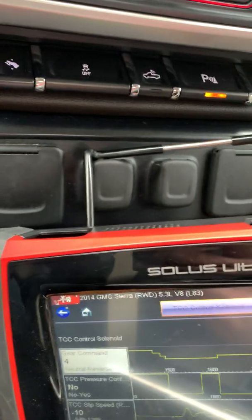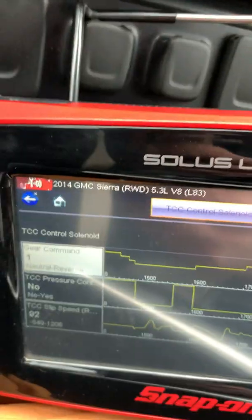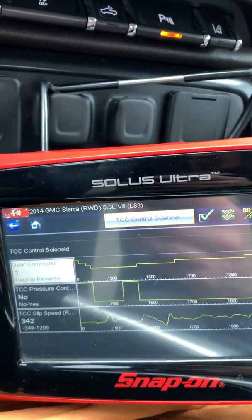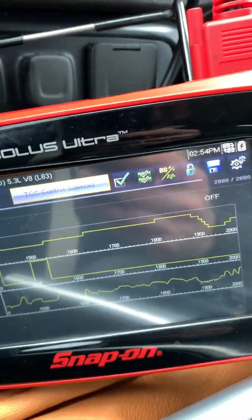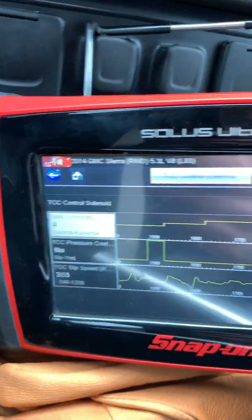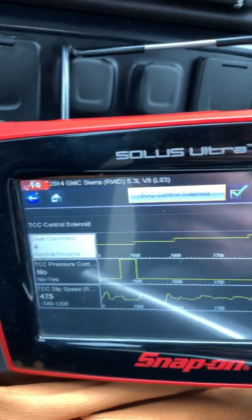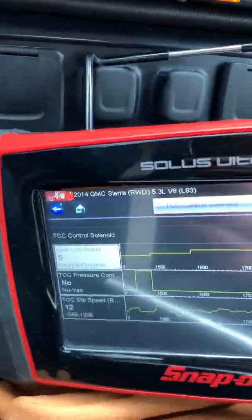You can tell that it's doing a ton of things at once. Another thing is the braking with the converter off is stronger — considerably stronger. You have to use less pedal effort to slow down the truck, and it's also smoother. I like it quite a bit. I also like the way it shifts with the torque converter off — it's faster, smoother, sounds more normal.